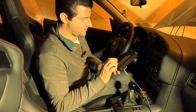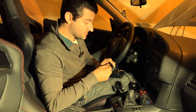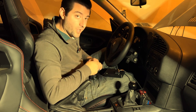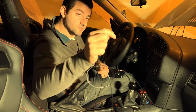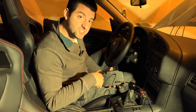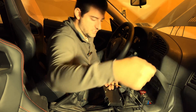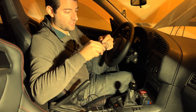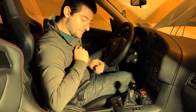I'm going to get a magnet so I can mount it right here. The other feature this has is a GPS antenna, so I've got to figure out a place to put that. It's pretty cool — if you have a car that doesn't have a functioning speedometer or you're wiring up from nothing, the GPS speedometer is a great feature. I'll have it on to show you guys how it works while driving. The antenna just screws in like that, and I'm probably going to mount it right over the top. The antenna cable is very long, so you have a lot of space to place it wherever you want.